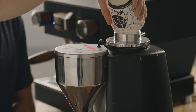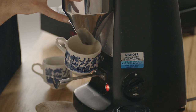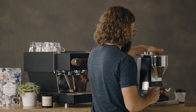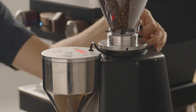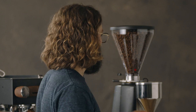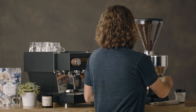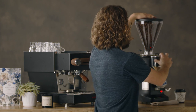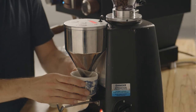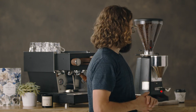So I'll put these right in here. I'm going to pretend like we're opening up the coffee shop again — I'm going to put my hopper back on and open this tab up. This barista was kind enough to leave a note for me saying 'grinder just cleaned, make sure to purge your coffee out.' So I'm going to purge the coffee out — like I said, about 40 grams, which is about two doses of coffee. When I'm done purging my coffee grinder out, I'll pull a shot, see where I am, maybe do a little dialing in, and I'll be ready to go.